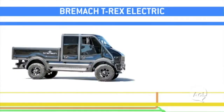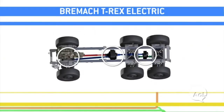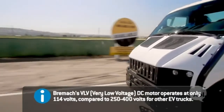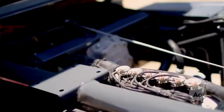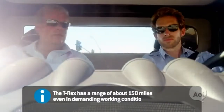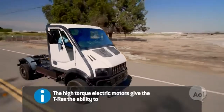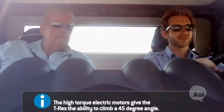You guys have done some really unique engineering on this vehicle, specifically with the motor. Basically what we've done — we ran a low voltage system and developed a system that allows us to have three motors mounted on a single shaft. Each motor is controlled by an individual controller, and technically only draws up to 600 amps. Because they're on a single shaft, three times six gets you 1,800 amps if need be. The biggest advantage is safety — at 115 volts, the odds of getting zapped and killed is considerably smaller. The other advantage is to actually reduce the cost dramatically. It's cheaper, it's safer, and it's better.